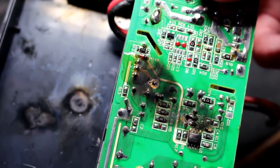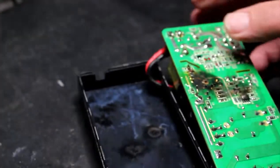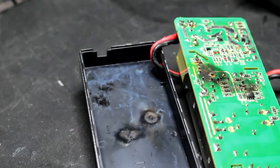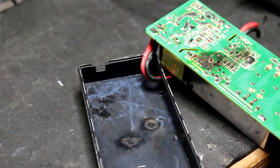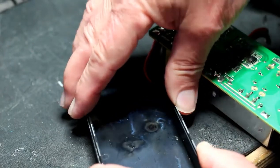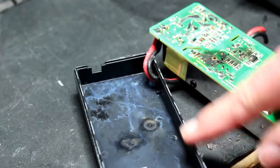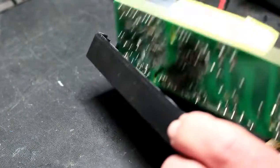We can safely say that is beyond economic repair. Just for those who are curious, getting these laptop-style power supplies apart requires a combination of cunning and extreme violence. My own preferred method is to put the whole thing into a vice and squeeze it in the middle - do the vice up until you hear it crack. As you can see, the gunk that was holding it together has parted company there. So that is not going to work again.